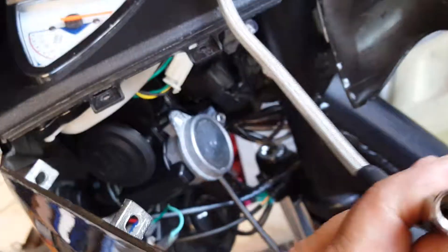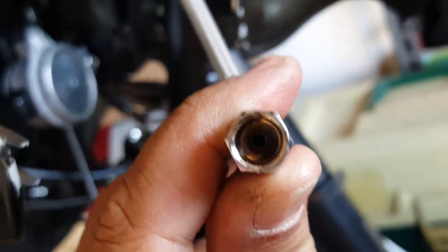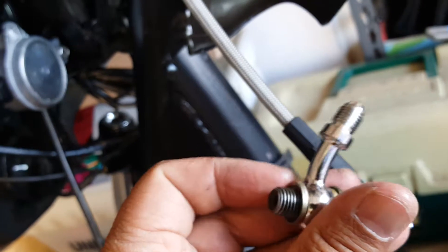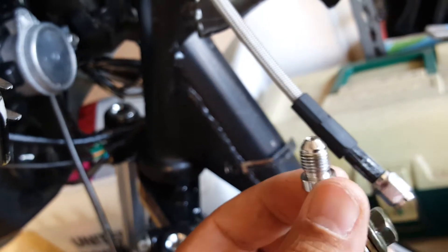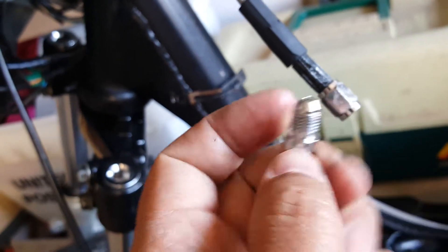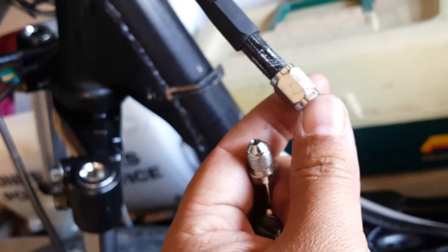You can see here how it's inside the cable — it's like a cone shape and there's a hole right there. Let me get more sunlight here. See that? Like a cone shape in there. That's the banjo bolt cone shape. So what I thought to do was use some special fuel-resistant silicone — not just regular silicone — and also some Viton rubber seals to put inside of it, to help block it from leaking through the threads.